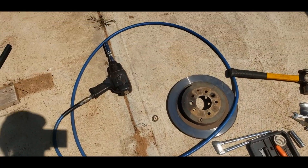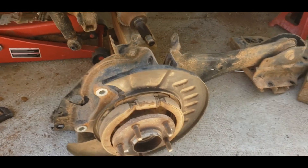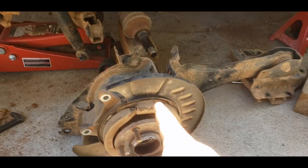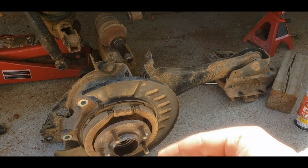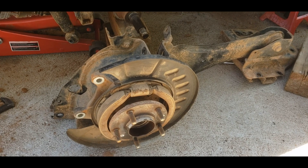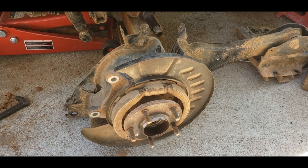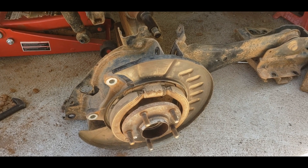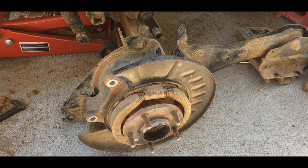Hello, I thought I'd make this video to do an overview and help some people out because this is quite a project. This is a Mazda CX-9, 2007 all-wheel drive. This is the rear hub — it's an entire assembly. This is what you have to take out in order to get the hub off and put the new one on, or if you wanted to press the bearing out and put a new bearing in you could do that too. Honestly I can't find the bearings — they just sell the assembly for the rear. For the front you can do either, and for the front it's a press-in, press-out bearing, so if you wanted to buy the whole assembly it'd save you some time if you wanted to spend a little bit more money.